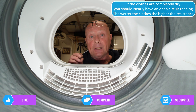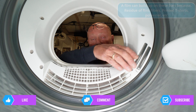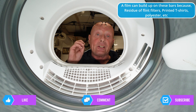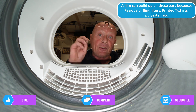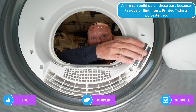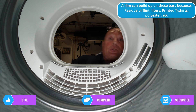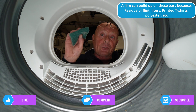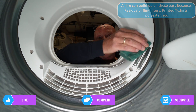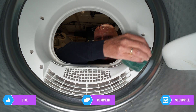If these two bars build up a film on them — a greasy tarnish on top of the bars — the computer will be getting a false reading. This means it would turn the dryer off early because it thinks the clothes are dry, but they're not dry. And this was the problem with this dryer — there was a large film on top of these two bars. The way you rectify this is to use a soft cleaning cloth with a bit of white vinegar, which will dissolve any fabric or particles that build up on the bar. Give the bar a good clean.